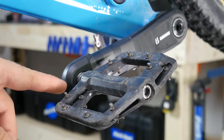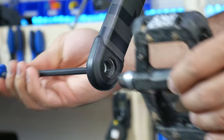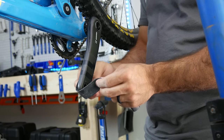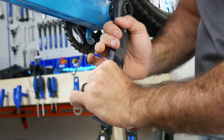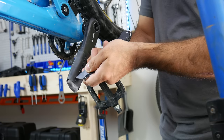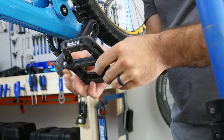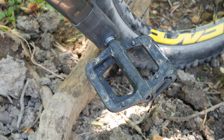These plastic or rubber caps protect the ends of your cranks, and you can hack them out of inner tubes. Take off your pedal and place a piece of tube over your crank, then slide a section of tube over it. It actually doesn't even look that bad, and the rubber is great for deflecting debris on the trails.